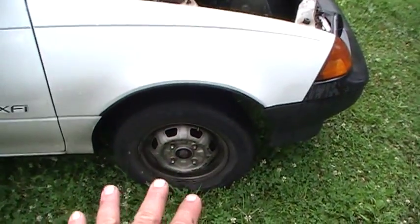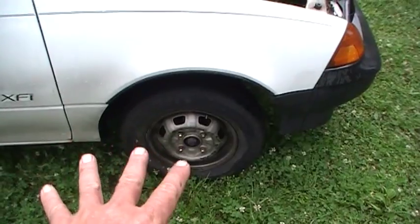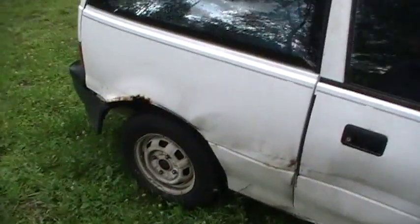Because prior to the horn completely breaking, it can just give, and they slam on the brakes and the whole wheel moves backwards. It's still functional. It'll work until you hit the brakes at the right time, and then the wheel snaps off and you have a tricycle.